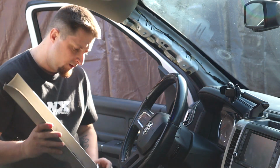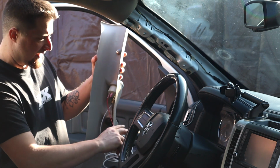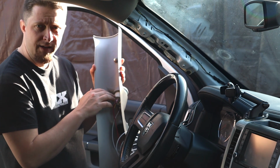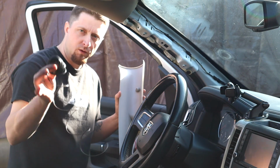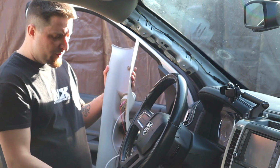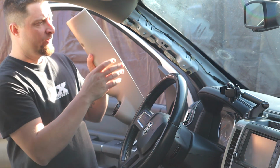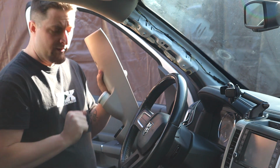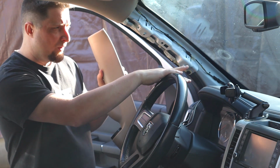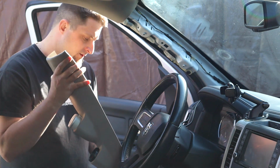As we kind of skipped ahead a little bit, here's our gauge pod. As you can see, it kind of looks like a spaghetti factory right now. I have the power wires ran to the gauge. Got our 12 volts and our ground hooked to the boost gauge, and it's literally just the whole roll of wire is just dangling because obviously I don't know how long we're going to need as far as wiring goes. So we hooked it to one end. We have our boost pressure hose laying here, and that way we can get this thing up there and mounted, and then plug in the wideband gauge, and then we can mount this panel back on and it'll be 100% done. And all we got to do is come down here and actually wire up the connections to the boost gauge. And then later down the road, we'll hook the boost hose to manifold pressure so we can get our reading for the boost gauge. But for right now, let's get this thing in place.